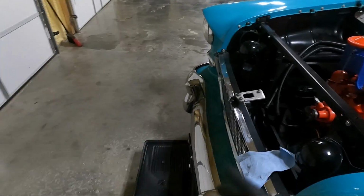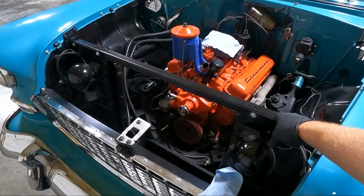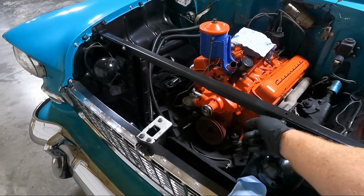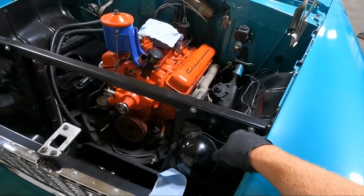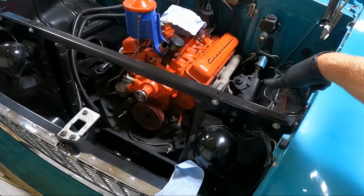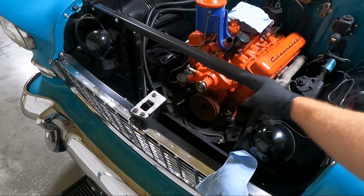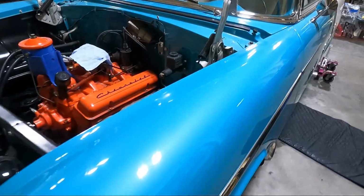I also think, I haven't talked to my painter yet, but I still think, guys, we're probably going to have to take this guy out. I just don't think we're going to be able to tilt that thing enough to get the motor out over this. It'd be really nice if this section right here came out, because we could leave everything else and just take this upper bar. But what I'm thinking is we may leave the closeouts and just take the bolts out, leave the closeouts on both sides, take the bolts out here and the bolts out in the bottom, and just lift that thing out, maybe giving us some additional room. Now, I may have to take the grill out as well, but just that much would give me so much more room to come up and get that motor tilting. But either way, let's get under this thing and see what we need to do.